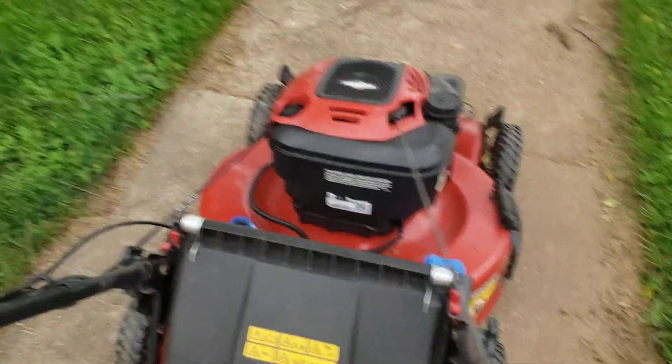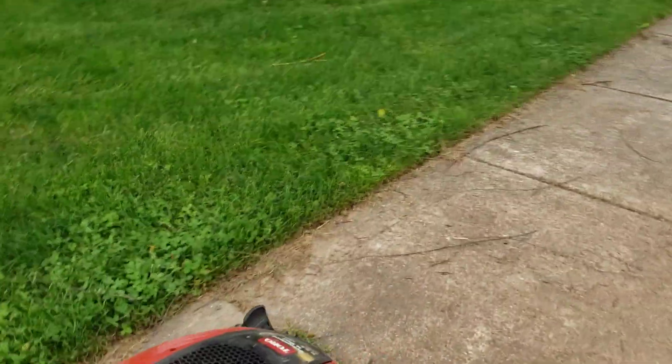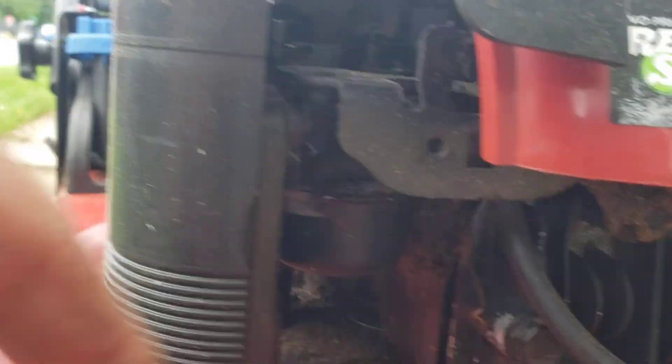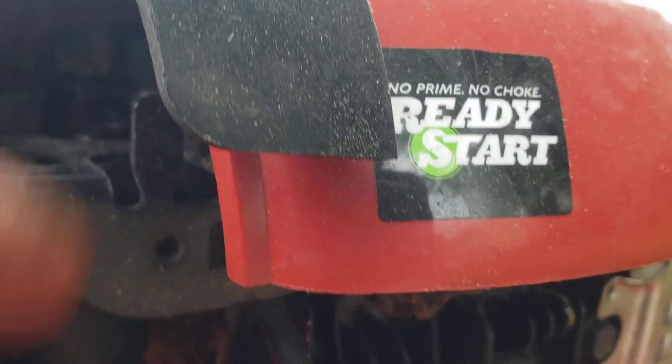Like I said, it's hard to pull one-handed in here. One area you want to pay attention to, especially if you get up underneath the bushes here — and I don't know if you can see that — but that plate there holds your governor's spring, and that was bent back.